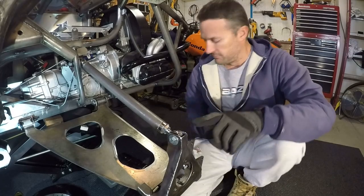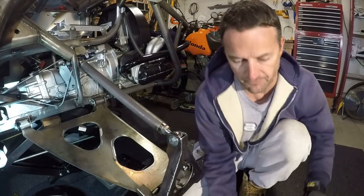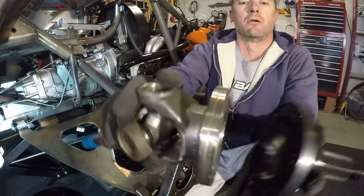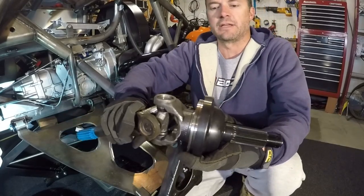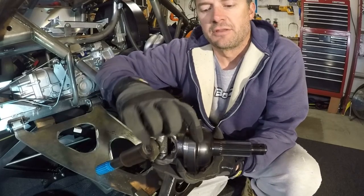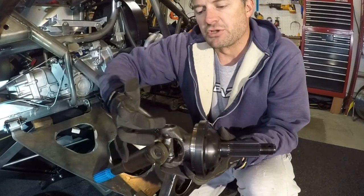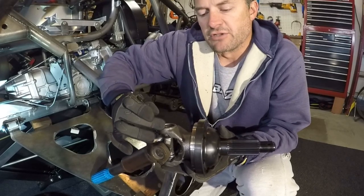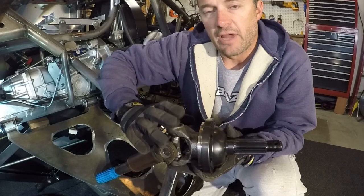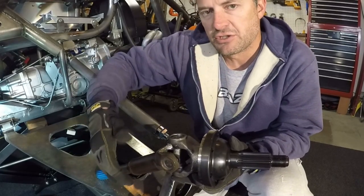To make it even more complicated — this is my micro stub axle and this is the adapter that would typically bolt on here. The CV cup and the adapter push my u-joint out pretty far, and the more it pushes that out, the shorter my drive shaft is. The shorter the drive shaft, the farther away those pivot points are going to be from the control arm pivot points, and every inch I shorten that drive shaft is just less travel I can get out of the suspension.